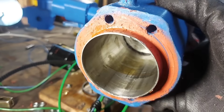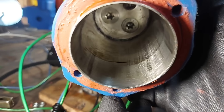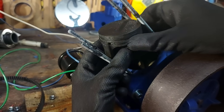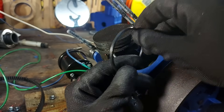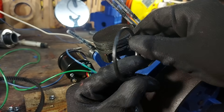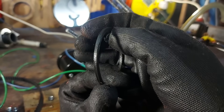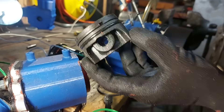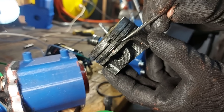The cylinder has minor scratches you cannot even feel with your nail, so the cylinder is still good to go. Even the rings look brand new. My theory on why they're not holding compression is that carbon fiber reinforced nylon is too stiff — it doesn't have the elasticity of spring steel, which is the material usually used in compression rings. But maybe we can use these rings as heat shields for our compression o-ring.